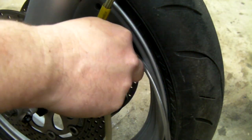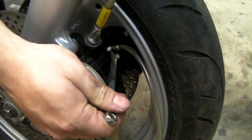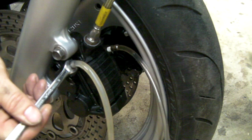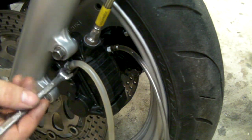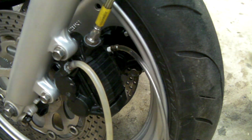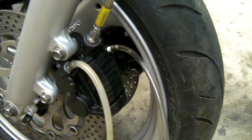Swapping the camera around — cracking that open, looking at the fluid coming out to see if there's any immediate bubbles — there are not. Let's have a pull on that one — okay, that's really good. There is some bubble in there — I can see it. A little bit slower — yes, there are tiny tiny bubbles in there. That's an absolute pain to get rid of — usually what I do is pin the lever back, leave it overnight, and come back the following day. It clumps all the little bubbles into big ones and then you can pump them through much easier.